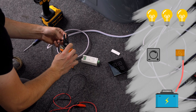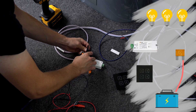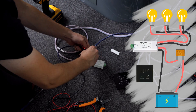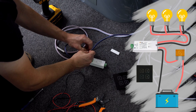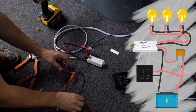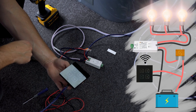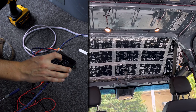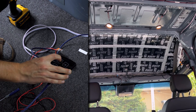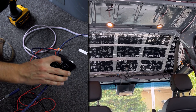For our lighting control, we are doing something a bit different. Normally there'd be a dimmer switch of some kind wired into your positive lead, which you'd have to send power from your lights to and through. We are going to be using a four-zone RF wireless dimmer system from Lunacy Lighting instead. The beauty of this system is you can wire the receivers — think of these as switches — at the source right next to your electrical cabinet. Then you run a separate 12 to 24-volt DC low-amp circuit to where you want the capacitive touch switch. Each switch can control four zones and you can teach multiple switches to the same receivers. Tap to turn off the lights. Tap to turn on the lights. Press and hold to either increase or dim. Each receiver will remember the last lighting setting, so no need to worry about that.